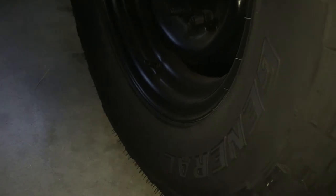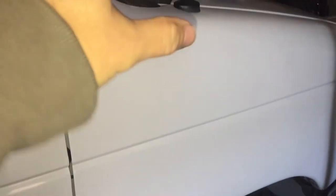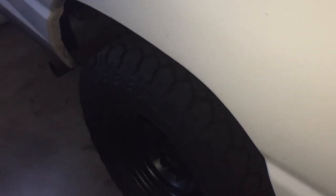That's what I got when the tires were installed, so I considered those guys professional and they let me drive out on 50. I'm going to hit the gas station today — maybe 70 in the back and 60 in the front. I think 60 in the front is good at all times because that's the fixed weight of the engine and you're not going to load more than that. In the back, when you're fully loaded, 80 PSI — so I'm not fully loaded yet, but once I am I'll go up to 80.